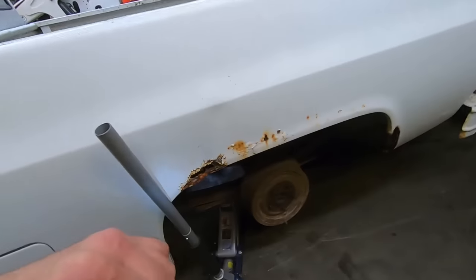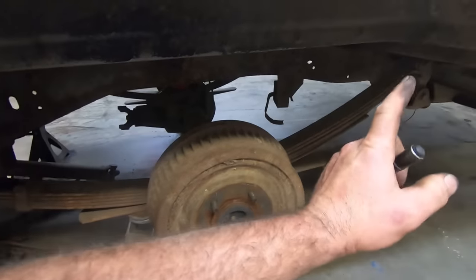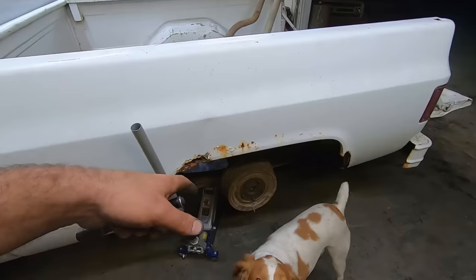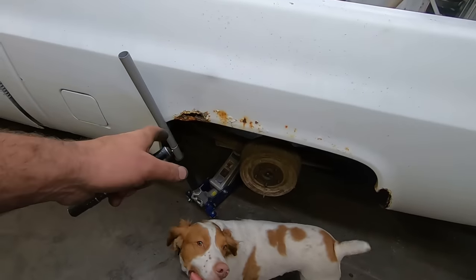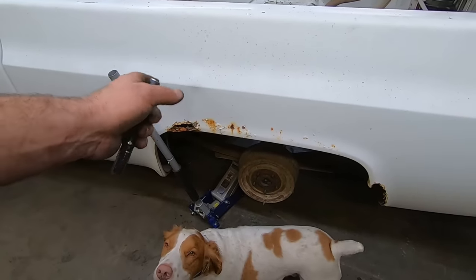And the holes for those springs don't really line up because the shackles are tipped back there. So it's kind of a two-man job. I was gonna put it with some ratchet straps, pull it ahead. I got some half inch bolts sticking there, but I thought, why go through all that? Just wait till we get the bolts and we'll snug it up. So once we get those bolts in there, we can hook the drive shaft up, the brakes up, bleed them, put our shocks on there.